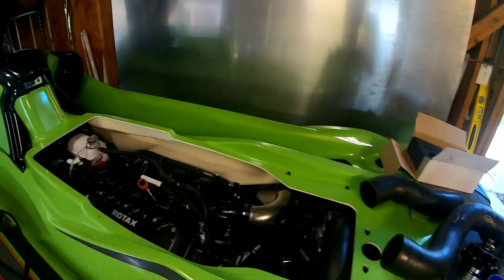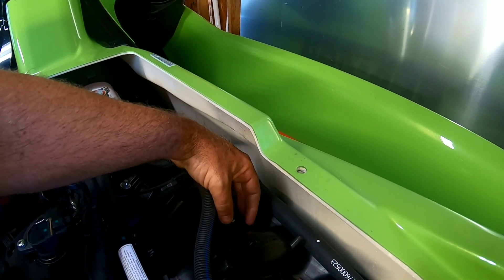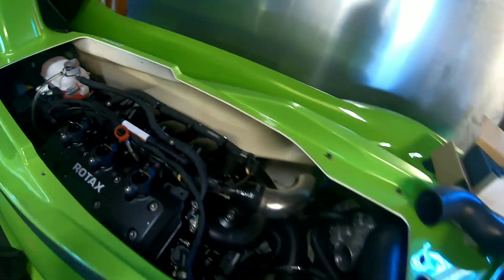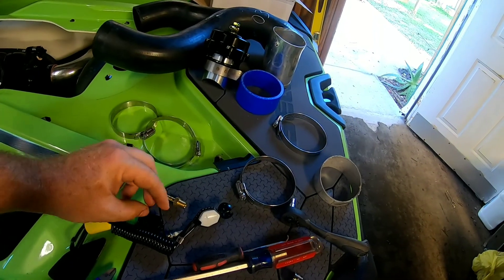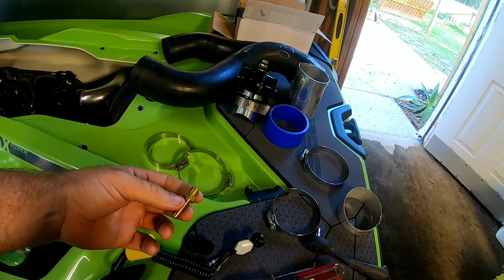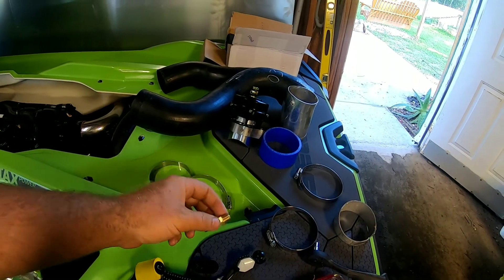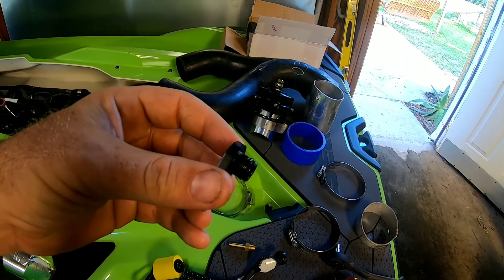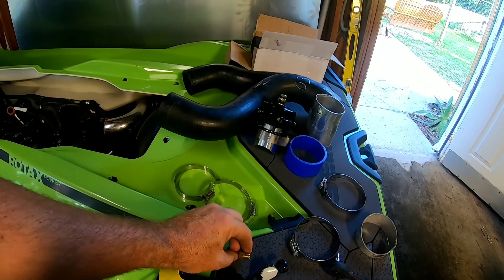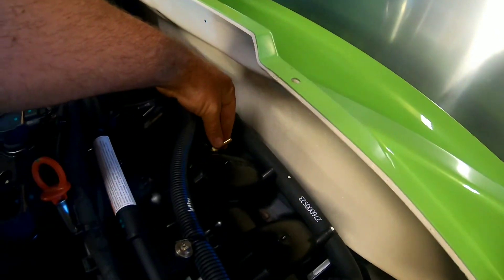As far as where I'm going to route to get a vacuum source, the only place you can pick one up is right here. On the older model 300s you have to remove your ECM to get to this plug — it's held in by one E8 bolt. I'm going to drill and tap it right here and thread one of these barb fittings in. I measured it with calipers at about 400 thousandths, and this fitting is 460 thousandths, so I'm going to pick up an eighth-inch NPT — this one here is quarter inch — something a little smaller.